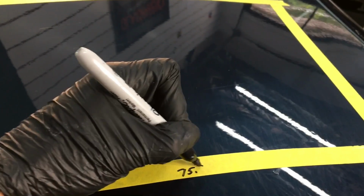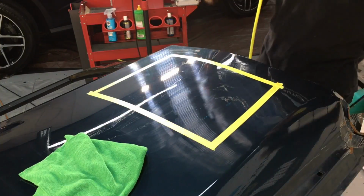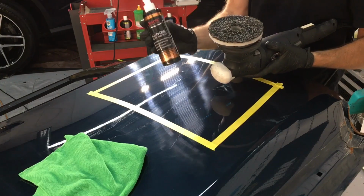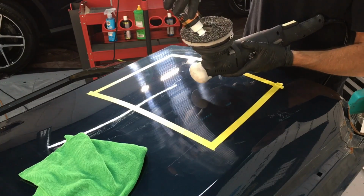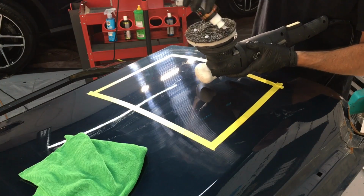So what I'm going to do is team it up with the Eurofiber pad. Once again, you could use their polishing pad, but I think the best teammate it will have will be that Eurofiber pad. So we're going to put 4 drops on. I'm going to go ahead, do the correction. We'll see what type of progress we can make with this all-in-one.